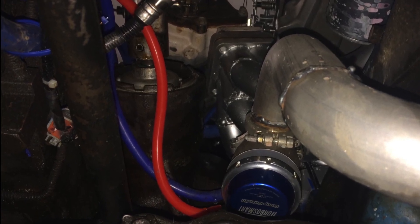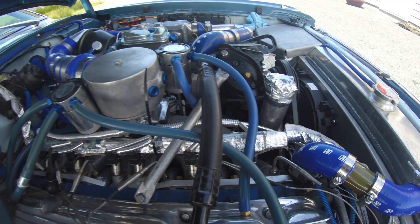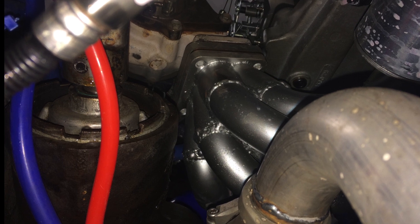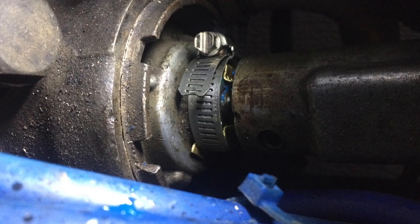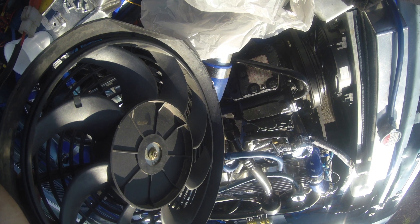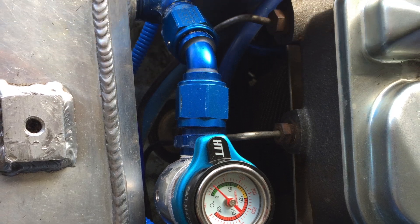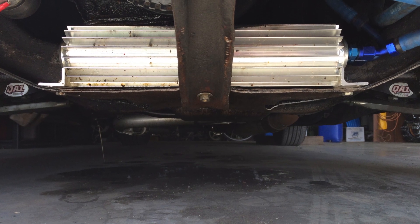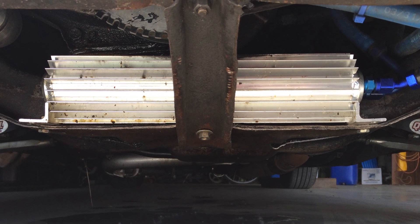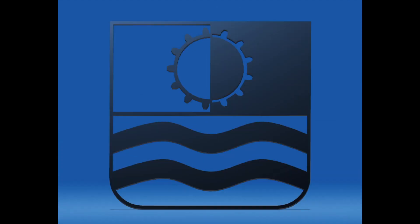With the turbocharging, even the power steering needs attention for cooling. Originally I used the stock power steering box with a federal pump and added a coupling and 90-degree fitting to reach the fill point, since the battery area is taken up by the turbo. On Route 66, the power steering fluid got so hot it pushed out the lip seal in the box, which sits close to the turbo. After the trip I put a Saginaw pump on with a remote reservoir housing with AN fittings up on the fender. The fluid was still getting too hot even on short trips, so we added a finned log-type cooler on the K-member, and that seems to be keeping the power steering temperatures down.